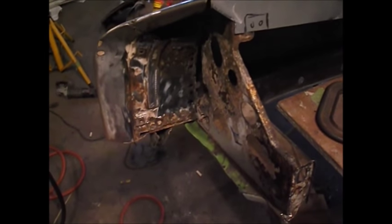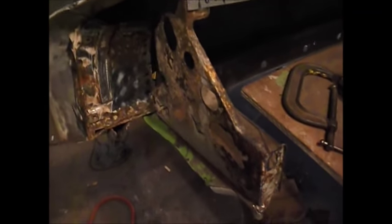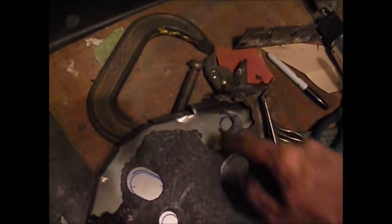I'm going to make this quick — the girlfriend's on her way over, and you guys know when the girlfriend or wife's around you can't do stuff like this. Anyhow, at least it's kind of hard to. Got rid of my spot welds. Got this nasty old piece out. Laid it on top of a piece of sheet metal, marked out my holes. I've got a couple holes — there's one up here. Of course, I didn't mark out the holes that aren't supposed to be there, but folded over my spot welds.